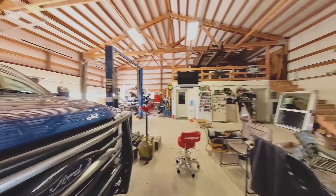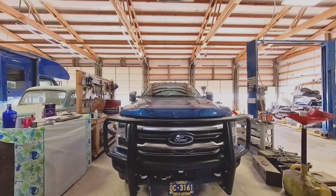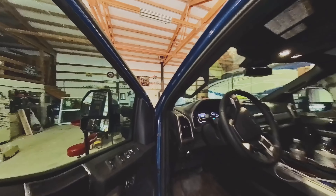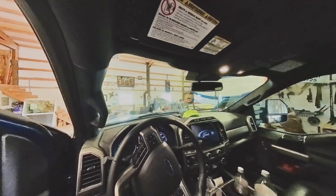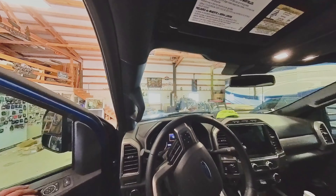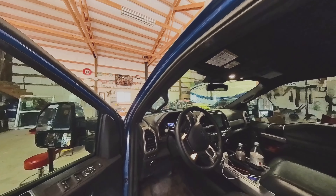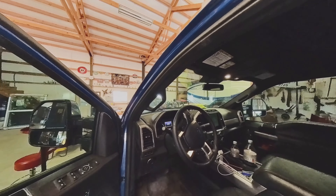I'm going to try to adjust the steering wheel since it's off just a little bit. I pulled straight into the garage and left the steering wheel at the angle it was while driving directly straight in. What I'm going to try to do is lengthen the drag link until I get the steering wheel close to square, then take it for a ride and come back and adjust again if needed.